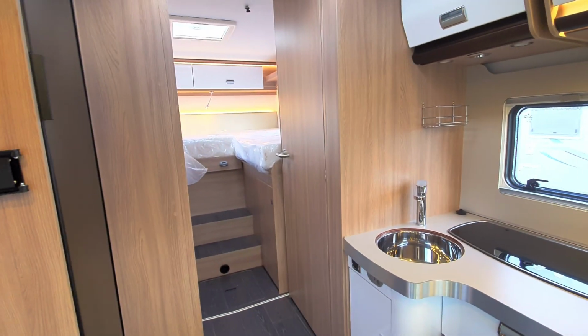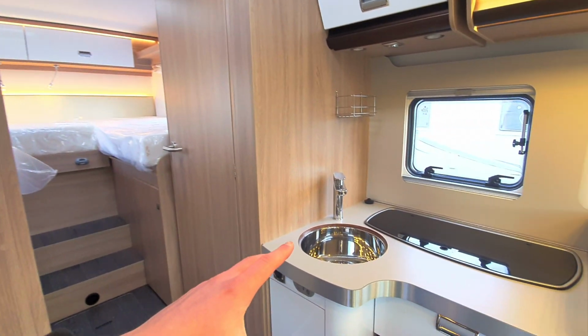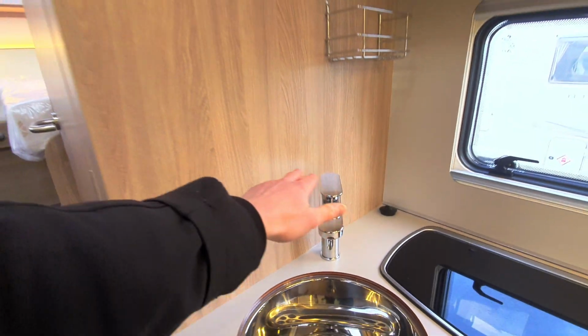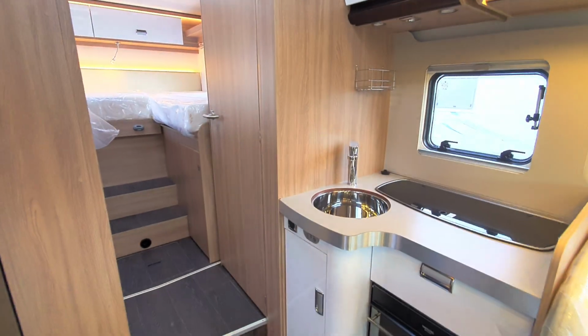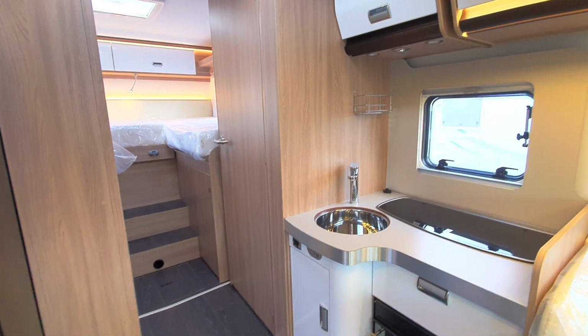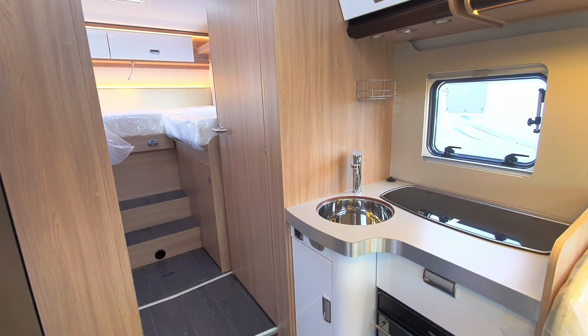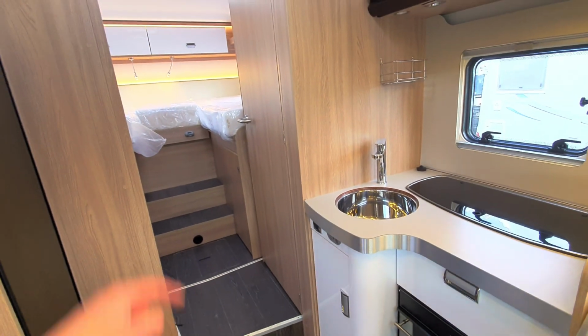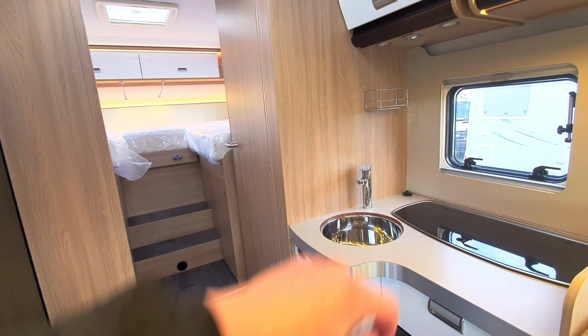Once you've done that, you can leave your pump on, providing there is water in the van, because each of your taps, including your shower, are on something called a micro switch, which will activate and deactivate the pump whenever you need it. So just like you're at home. Now the reason I always tell you to do it on hot water first is that will pull, as I say, water through the boiler.